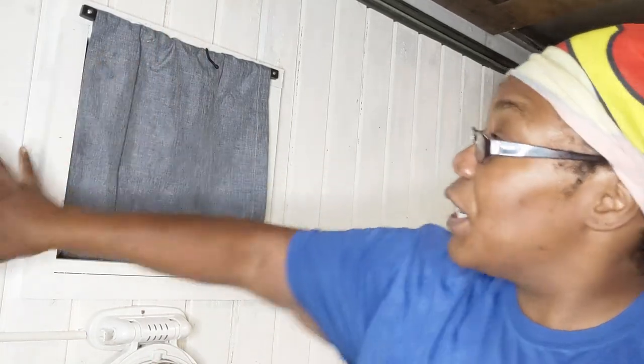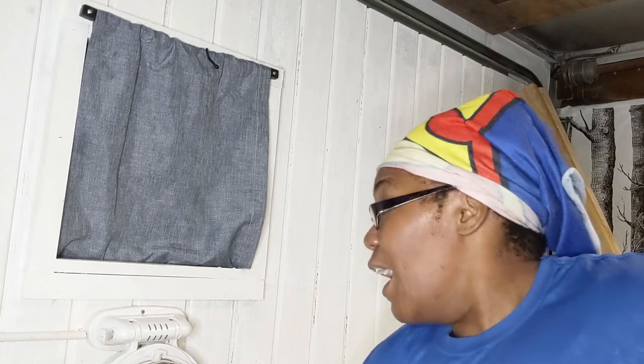If you can afford to have somebody else just cut the hole, take your vehicle to a shop, let them know you have your window, give them the size, and let them cut it for you. It's not a bad deal because the installing of the window is actually pretty easy once the hole is correct. You butyl the window — which is what I did for all three of my windows, I used butyl tape — set the window into the hole, and you have a framing mechanism that goes on the inside. You screw it in from outside, put on some extra sealant if you're worried about leaks, and then you're good to go. None of my windows have leaked since I put them in. I've had a couple of experiences with rain and nothing is leaking — everything seems fairly sealed up.